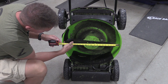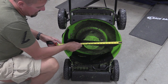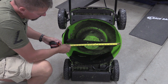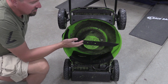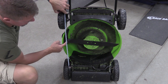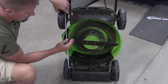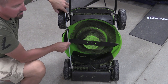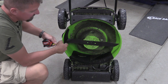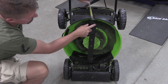This is a 21 inch mower, so I like to pull out the tape and measure the blade — it comes in at exactly 19 and 7/8 inches. Where do we get 21 inches from? Normally that's from the outside of the deck, which measures 21 and 9/16 inches, while inside the deck gives us 20 and 3/4 inches. So there's nothing actually 21 inches here — you're realistically getting just under a 20 inch cut. Looking at wheel alignment, we're getting approximately 1.5 inches of blade going over and outside the wheels.